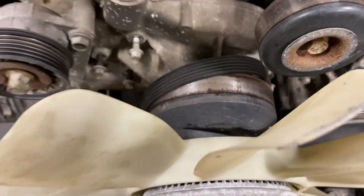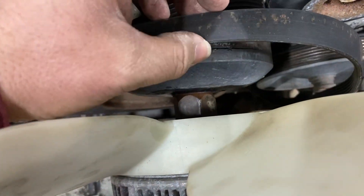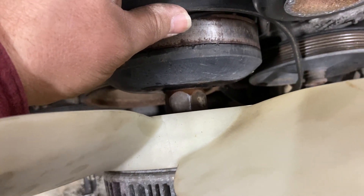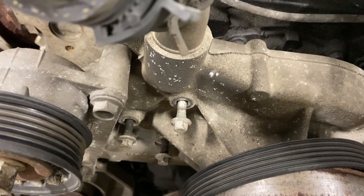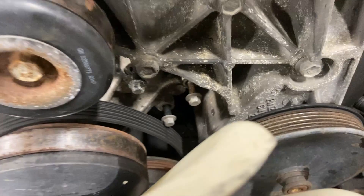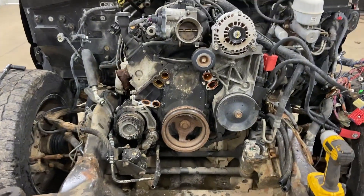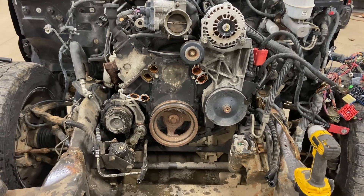Removing the fan — usually you can leave the belt on, put a really big wrench and smack it on that nut right there. But this one seems to be rusted and seized, so we removed those three bolts. The water pump is now off and out of the way.